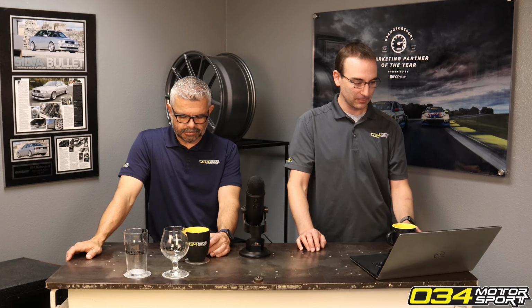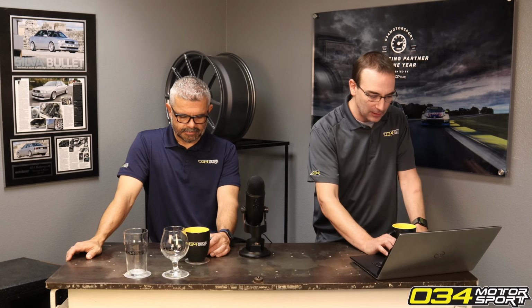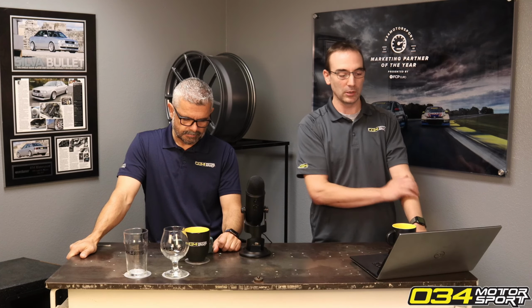Does the increased clamping force with the TCU update shorten the life of the DSG? I don't even see that question. It's quite the opposite. It actually increases it. Basically, what we're doing is limiting the amount of slip that those clutches are seeing. So we're trying to proactively clamp down on that clutch before it gets into a slip condition, and then has to reactively try and apply more and more pressure.